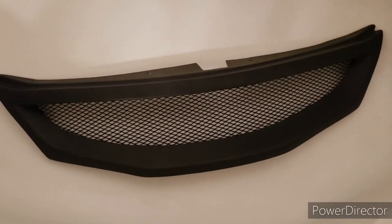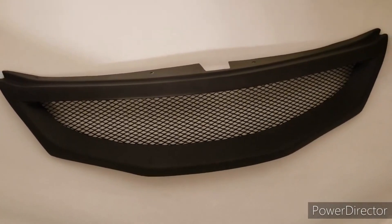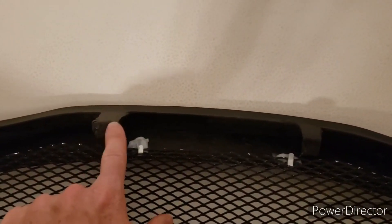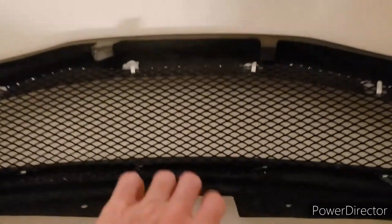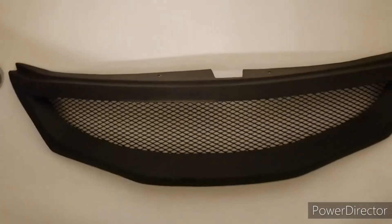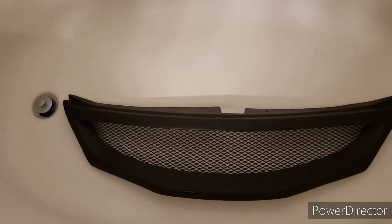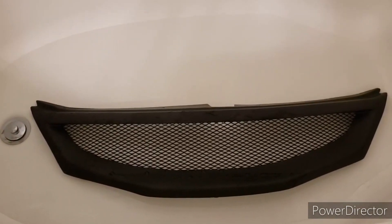The grill came in and as you can see I'm gonna need to get a finish on it — it's just flat black right now. The holes on top are pre-drilled, but on the back side they are not, so all these tabs here, here, here, and the one on the end will have to be drilled so you can secure the bottom to the car. I'm going to drill those out and then wet sand this to get a good finish before we get it on the car.